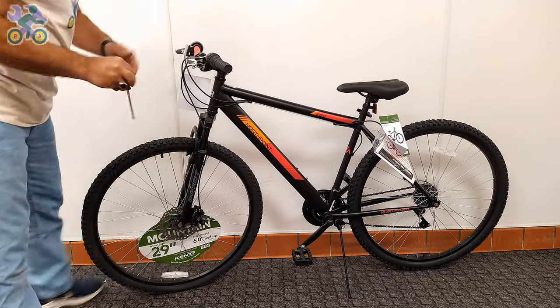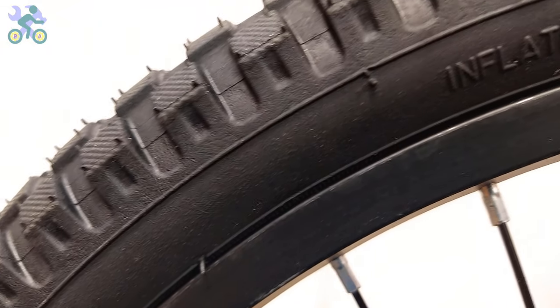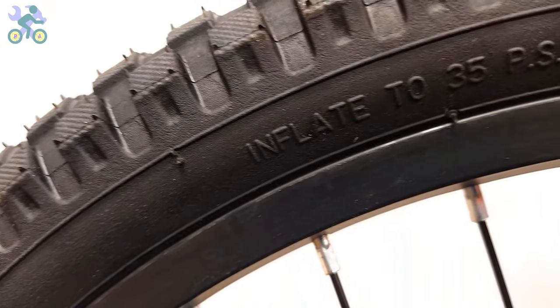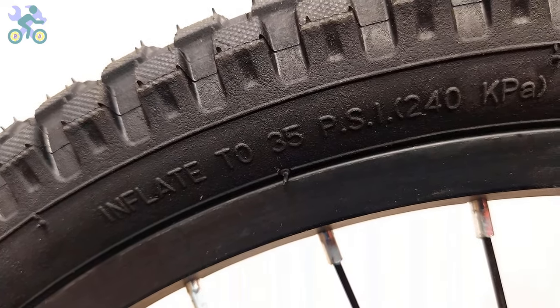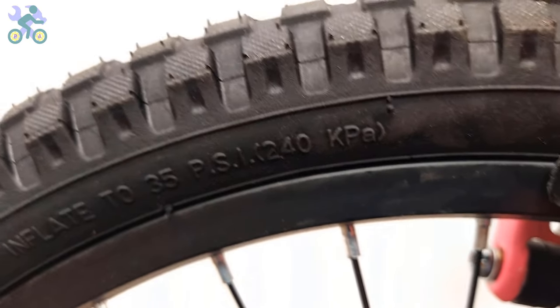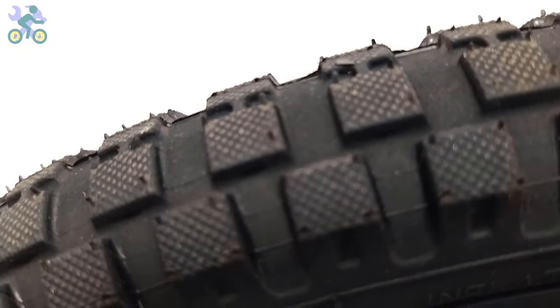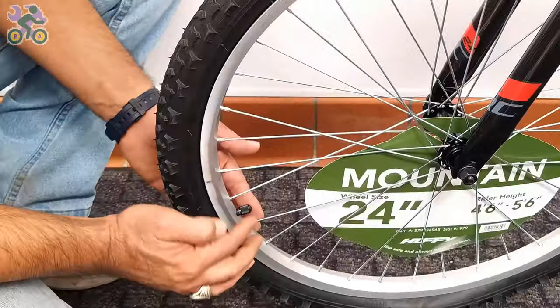At the end, it's necessary to check all the work done and make sure that all bolts and nuts are properly tightened. When inflating tires, some people inflate to the amount indicated on the tire — however, the value displayed on the tire represents the maximum air pressure the tire can withstand. For most bikes, the recommended air pressure is between 25 to 35 PSI. After inflating to 20 PSI, sit on the bike to check the tire pressure — if the tire is not fully inflated, increase the air. Remember, the weight of the cyclist determines the amount of tire inflation.